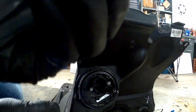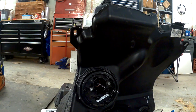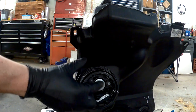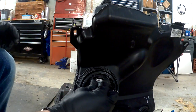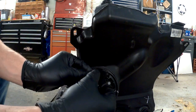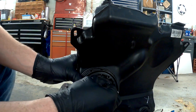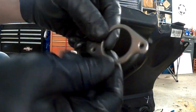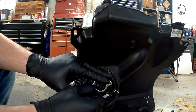There's the old filter — they get this color when they've been used, but it's just not the nicest looking. Grab your new filter, all you do is shove it in against there. Make sure you put everything back in order. Grab your wave washer and put it against your canister housing. Take your fuel filter nozzle — as you can see, you can't put it on backwards. Give it a little twist since I never oiled that O-ring. Make sure you grab the flat-sided piece — it has a flat side and a round side — put it on there. Then put your two Torx bolts back on.